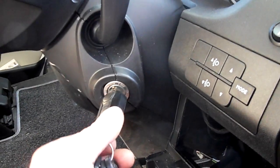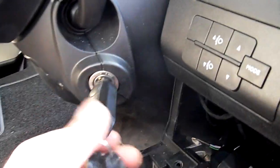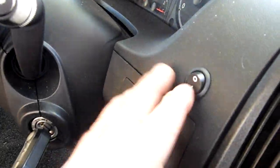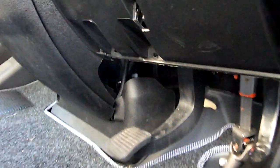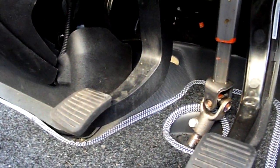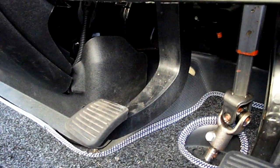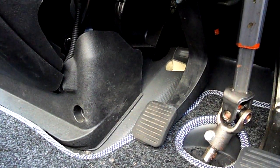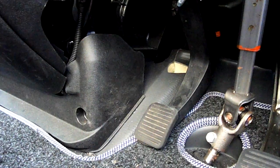And this is how the system works. Basically you start the vehicle making sure it's not in gear. Switch on the Auto Clutch master switch and then depress the brake — this is your starting functionality. So when you depress the brake, the clutch pedal disengages, pulling it all the way to the floor, and you can select first or reverse.